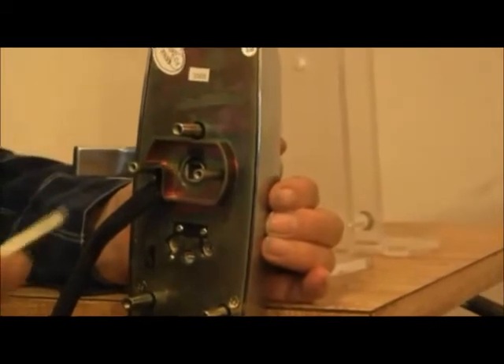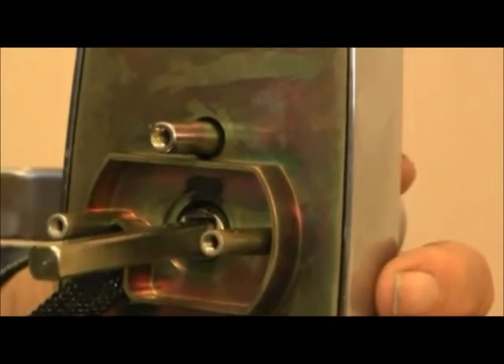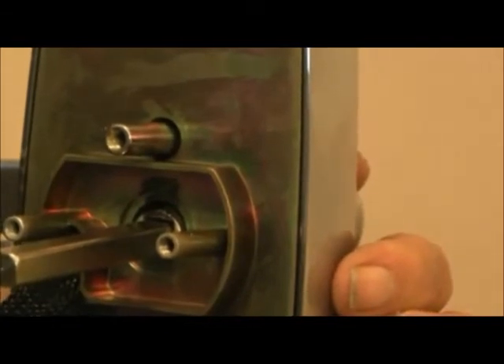In addition, we have the solenoid registration — this is one of the most important steps. To do this, use the outer portion of the lock and insert the tail piece into the motor. You will see two black marks: a black mark on a rotating ring and a black mark above it that notes the proper positioning. Rotate the ring fully counterclockwise until it stops, then rotate it fully clockwise until it stops, then rotate it counterclockwise again until the black mark points straight up, lined up with the black mark above it. If this is not done, the lock will only work intermittently or not at all.